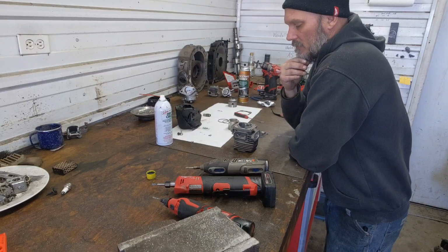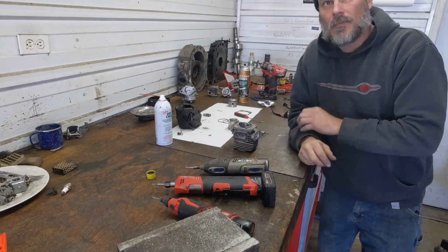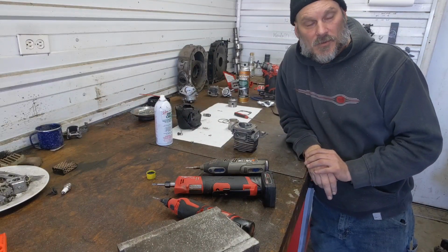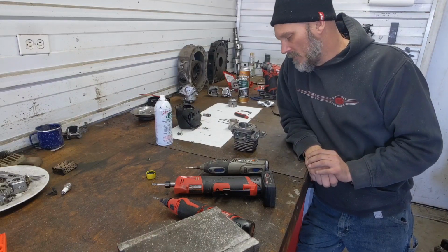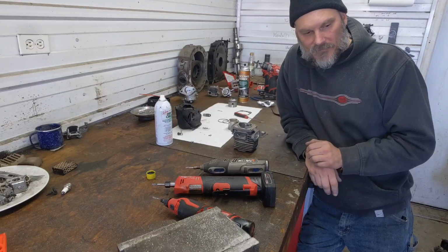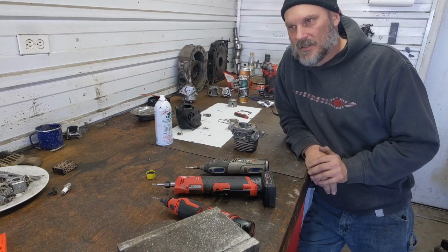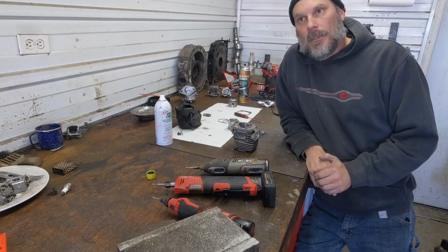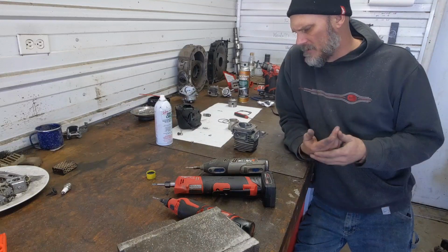A little bit more aggressive on the timing, but for guys that are do-it-yourselfers at home, this reminds me of when they had the 365 372 XP Torx. The 365, the only difference really was a splitter inside the transfer cap, and guys were popping the cylinder off and removing that splitter, essentially making it a 372. They do very similar things in the 550 to the 545. The transfer caps are smaller in the 545. And all the way down the line to the 565 doesn't have crank stuffers like the 572. The transfer caps on the 565 are about 25% smaller volume. So that's how they detune these things.